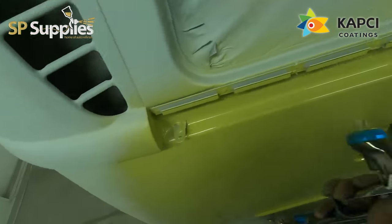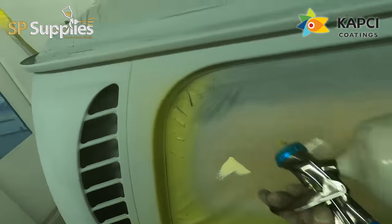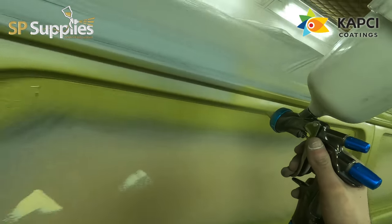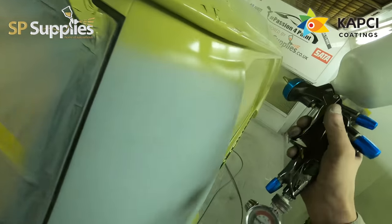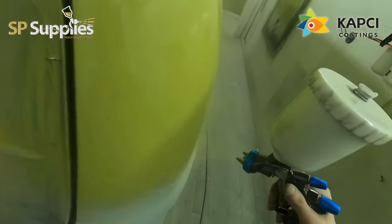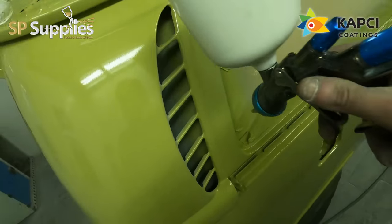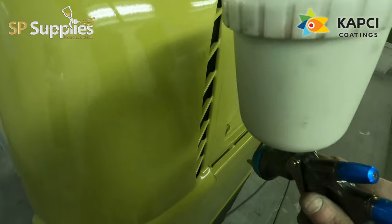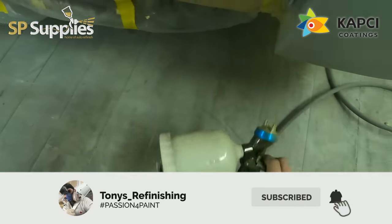In between coats I'll give it around about a 10 to 15 minute flash off. This first coat I'm going to be going across with a nice 50% overlap and then I tighten it up more and more as we go into the consecutive coats, just to get it wetter and wetter and obviously up to full fluid. With 2K gloss the one thing you do want to just be a little bit careful of is that if you do get a run, then all the pigments in the colours tend to pool up, and where the run was, although you can get it flat, you do sometimes tend to end up with a slightly off patch, a bit of colour. I just want to say a big thank you to everyone that's subscribed recently - there's been a lot of new subscribers. If you're not subscribed, please do hit the bell for notifications on new uploads, and also hit that subscribe button and leave a comment if you enjoyed the video.